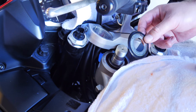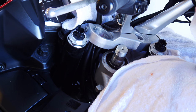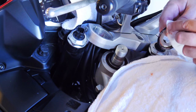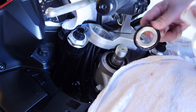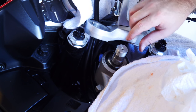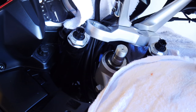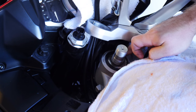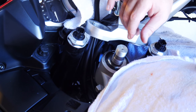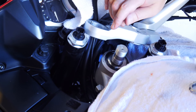Now it's pretty much the same procedure as torquing our steering nut. In goes our bearing cover — wipe it off well and hit the underside with a little bit of grease. You don't have to go crazy, just get a nice fresh thin coat on all the underside of the rubber. Slide it down and press it into place. Now comes our first nut — the order is nut, o-ring, nut.